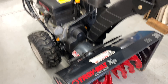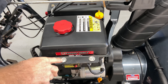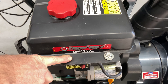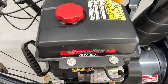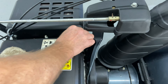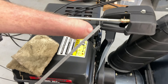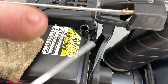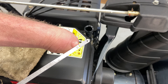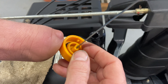First thing I always want to do is check the oil. Since we're here at the engine, it says it's an overhead valve 357cc engine, which is approximately about 10 horsepower. Check the oil right here — it's just a half turn. I just changed the oil and it's very clean, but as you can see it has two dots and a bar graph on one side.